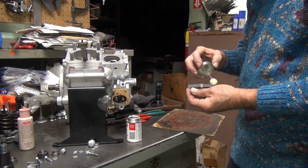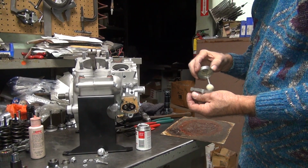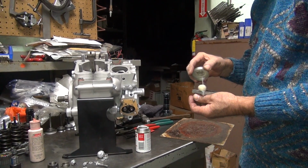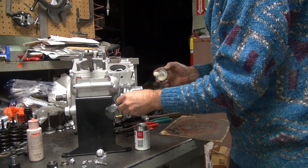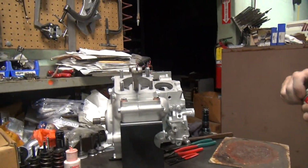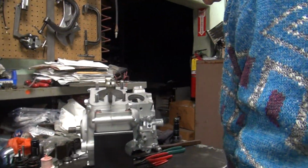I like that thickness for my race bike. It's good. See, I don't use gaskets for race bikes. Yeah, no gasket, right. So, a nice thick layer, gasket grip is perfect. That thin runny stuff doesn't work very well, especially when you torque it down. Yep. All right.